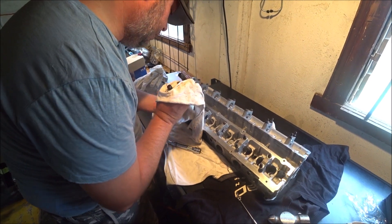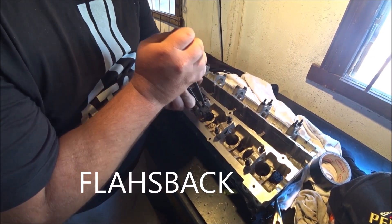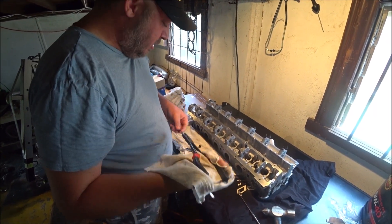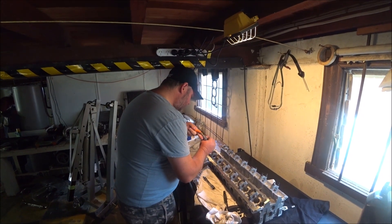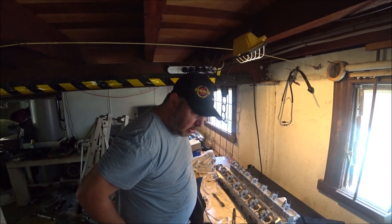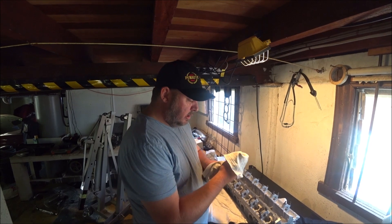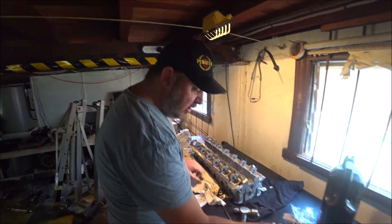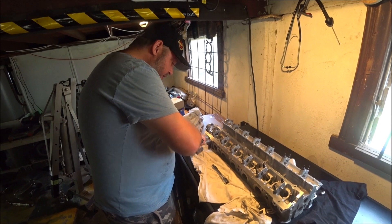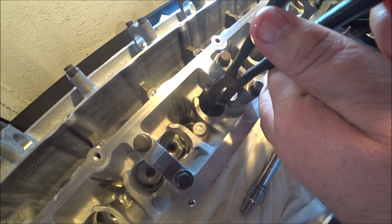I know I was in a hurry when I did it, but that's ridiculous. Be careful not to punch yourself in the face — that's what I was talking about. I'll get in there with some isopropanol just to clean those stems real quick. After I do this, the point of this video is to show you how to put it together, not take it apart. So I've got my valve stem seals here just soaking in a little oil.